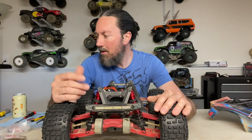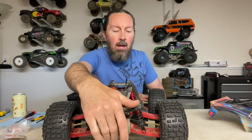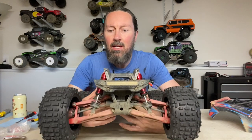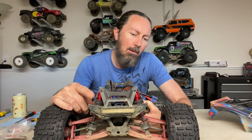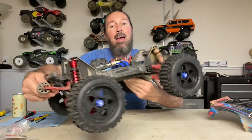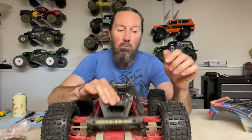You can add whatever weight oil you want. I'd maybe start out close to stock - 40 weight is stock in the back - maybe go up to 50 or 60 depending on what you're doing. I assembled mine with the M2C pistons because that's what I had, and that's what I have up front too. I'm running VG progressive rate springs and M2C shock pistons up front, with about 40 weight. In the rear I mixed a little bit of oil so it's approximately 45 or 50 weight.